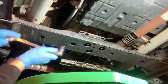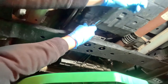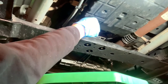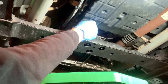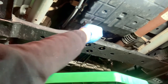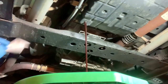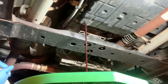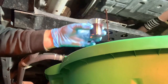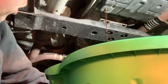We'll go ahead and remove the drain plug — that's the 19mm. I've got a shot glass here on standby to get a little sample just to see what this fluid looks like. Yeah, pretty dark. We definitely needed a flush here. I might have to flush a little more of this than I wanted to.